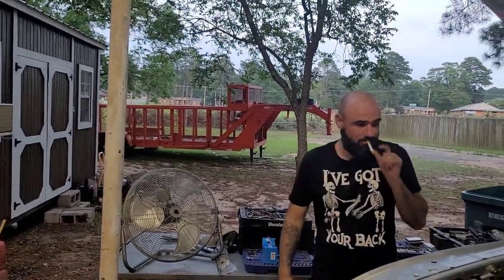What this truck is doing, it's misfiring really, really bad and running rough. I mean, really bad. We've replaced every sensor we know of. What happens with these Hemis is they've got this module on there that kicks it from V8 to four cylinders. And that's not good on this engine when you're pulling a big gooseneck trailer. My dad is in lawn service, so when he's pulling it, he doesn't need the truck to keep going back from 4 to 8. He needs all the horsepower he can get. Dodge should never have put that on this type of engine. But they did it, and I think there's a lawsuit going on about that. I'm not getting into that in this video.